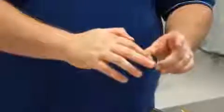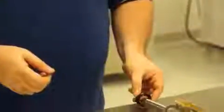The only part on the beater body that gets lubrication is the beater seal, and it should be done only on the internal surfaces. There is no need to run lubrication in the outer trough. Once lubricated, you'll slide it on to the back of the beater. And that's the beater reassembled.